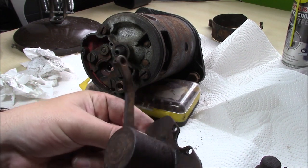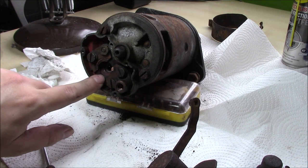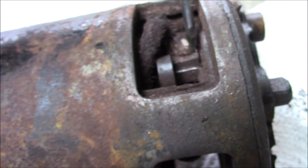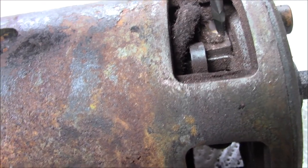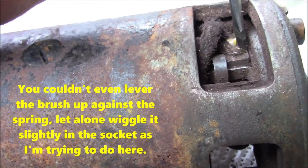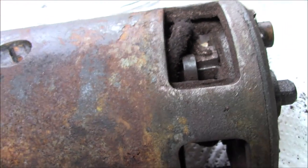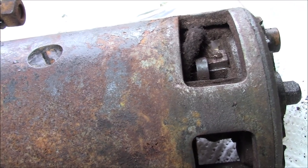So our first course of action on this is going to be a jolly good clean, because I think once these plates are cleaned up and the contact here is cleaned up, we'll have a much better chance of getting a decent connection. Where the screwdriver there is, that's the brush. This is the spring, which is supposed to help it bounce back into place. But the brush itself is really stuck - there's not really any free movement there. But we think when you actually tap the case, which usually gets the starter motor to go, it's just given enough of a shock to free that up. So I'm going to put some switch cleaner in here and see if that's enough to just dislodge enough dirt to get it moving again.